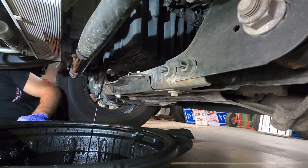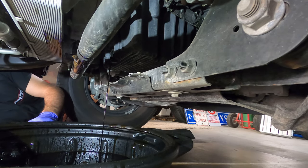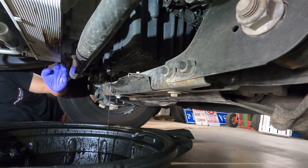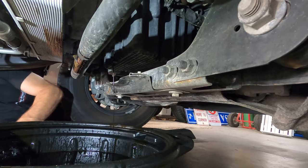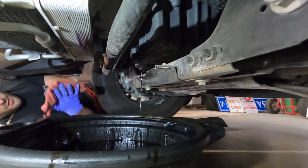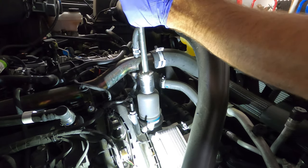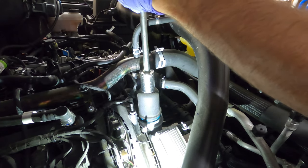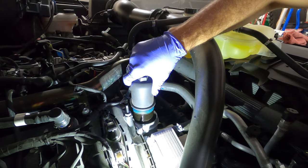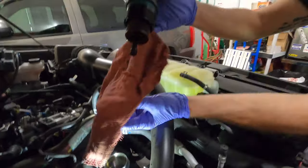The oil filter suspends oil up inside its filter cavity. When you take the cap off, the oil that was suspended in there is going to drain back down to the crankcase. So you want to make sure you have that loosened. I should have done that before, but I wanted to get the hot oil out first. I've got my 27mm and we're going lefty-loosey. You can see it coming out of its bore on the front cover — it's got a double o-ring. I can hear a little bit of oil starting to drip into the drain pan now.